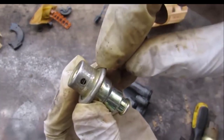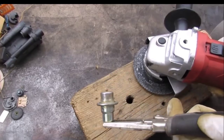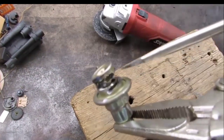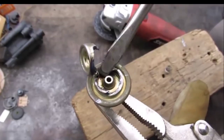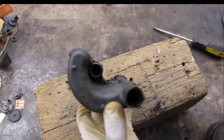Fuel will go in here. There's a little spring on the inside that, when enough force is reached, will allow excess fuel that's over pressure to escape back into the tank. I'm going to chop it open to show what's inside — you can see there's a little spring, and this is a little membrane inside here that moves up and down according to the pressure.